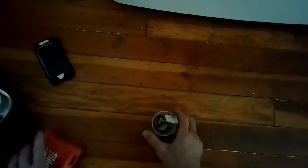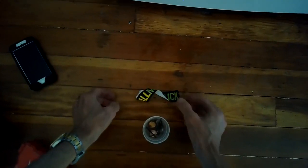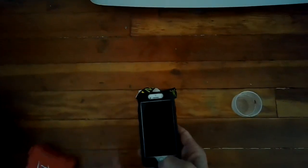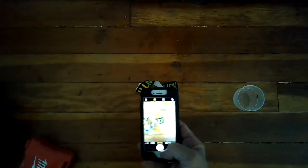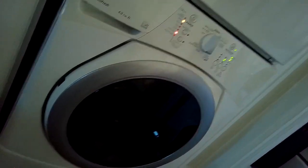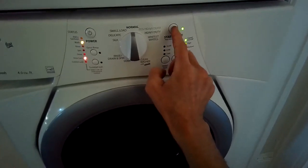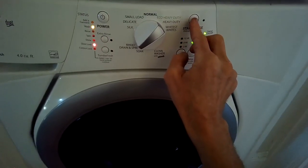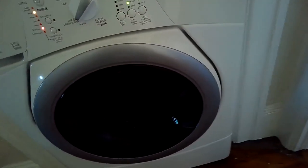Now that we've got the obstruction out of there it's doing good — it's draining as it should. Some people ask what to do about small items. Here's what was in there: a sticker and a bunch of coins. For little socks I tell them put them in a knit bag — same thing with bras, which sometimes have a wire that will sneak out and get caught in the drain mechanism. Small underwear items or small socks I would put in a knit bag — they still get really clean but it's very unlikely that it would jam up the pump. Hope this has helped you and please subscribe to our channel when you get a chance. Thanks for watching.